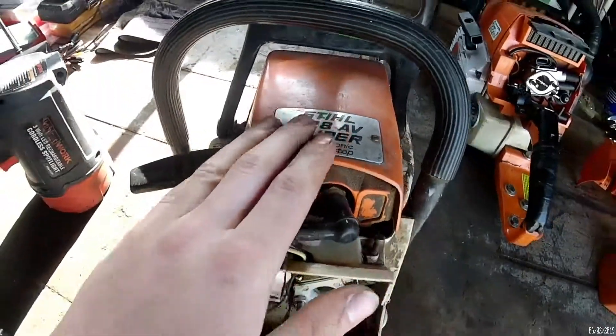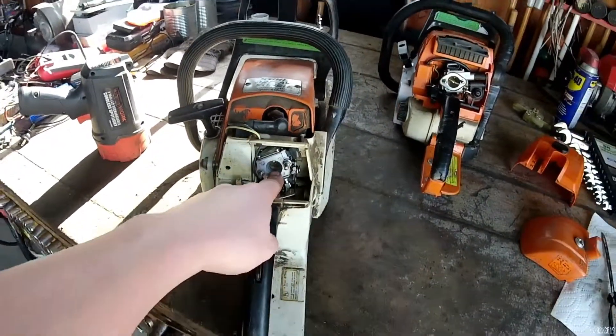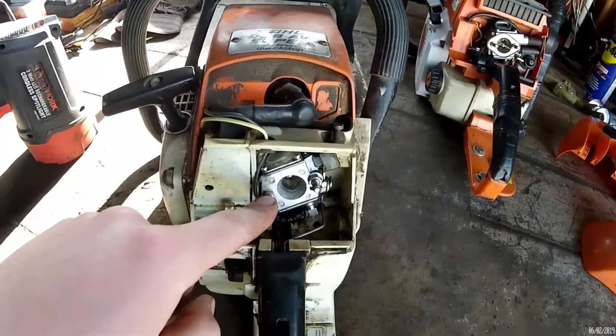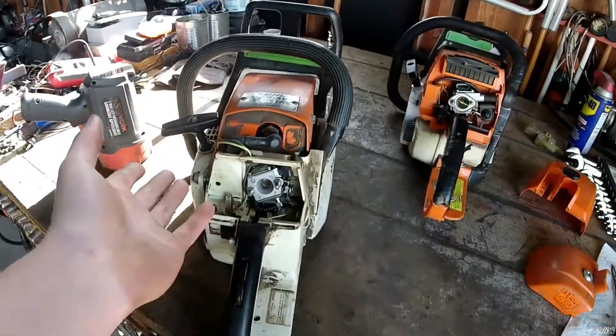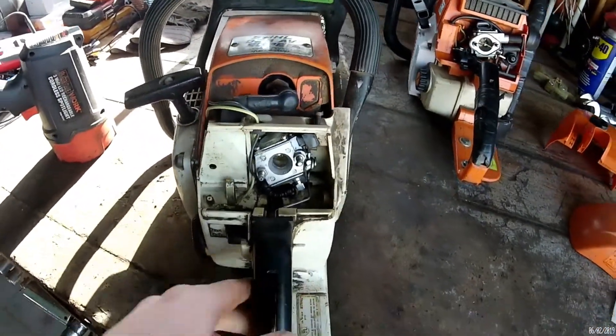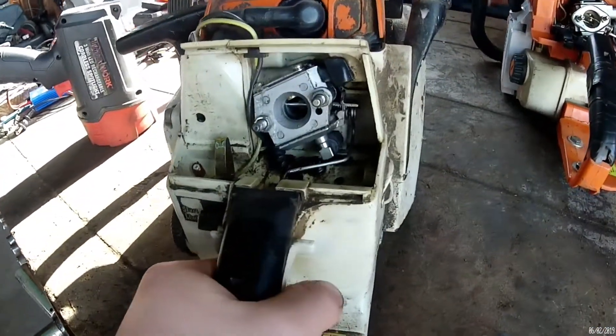That's my take on the Stihl 028. If somebody knows a lot more about these things than I do, please let me know. Does this carburetor have like a self-priming or self-choking style system? I tore the whole carburetor apart and cleaned it — that's the only way I was able to get it running good again. If you guys know anything about this carburetor, please leave it in the comments below. Maybe I'm completely wrong and it actually does have some other choke or prime system inside. I did not see anything like that when I tore it apart, but now it's back to starting as it always has. Thanks for watching, guys. Be sure to subscribe and like this video, and I will see you next time.